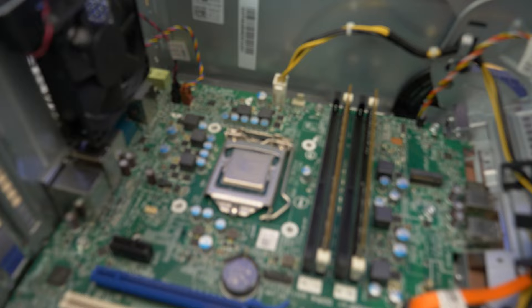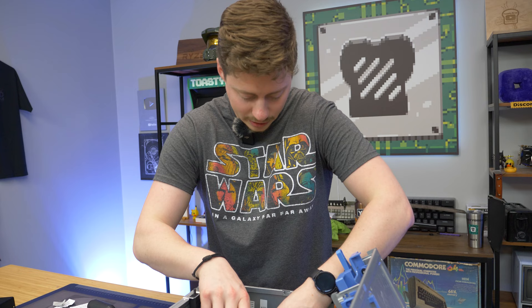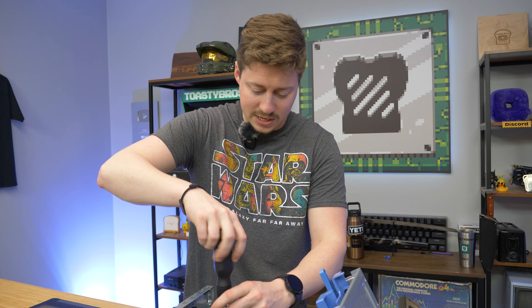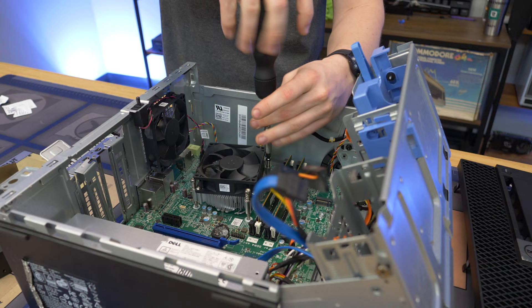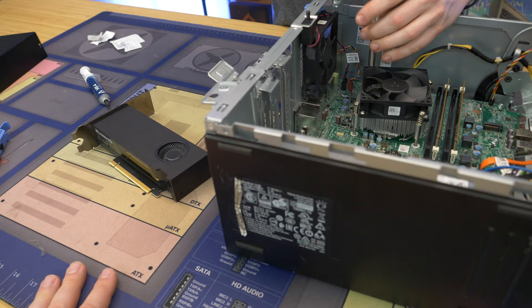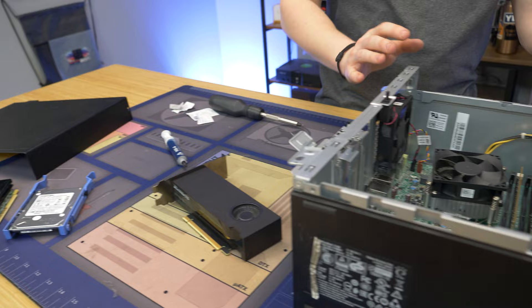Let's go ahead and get some new Arctic thermal paste on here, just so that this thing has the absolute best case scenario. The 6th-gen i7 is a four-core, eight-thread chip — it's pretty similar to something like the i3-10100. But if you ever have the chance to build a new system, the i3-10100 is going to have longer support and is a little bit faster, especially in single-core performance. So if you get the choice, definitely go 10th-gen i3. But obviously you don't really get a choice with something like this.